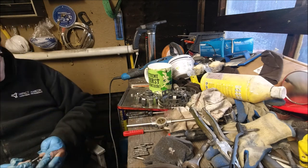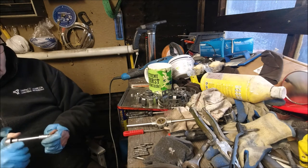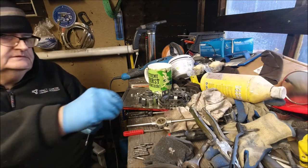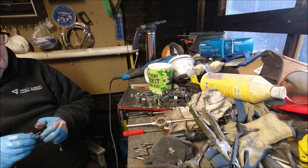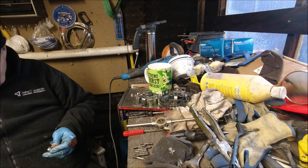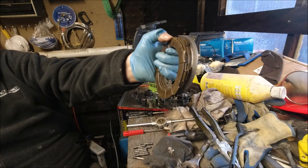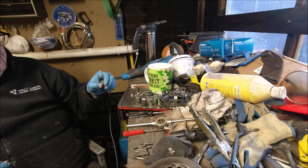What I've also been doing is checking out the clutch bits, and it looks like the corks themselves have been bashing on the outer bell. Let's just turn that round and do that end. So I'm going to order a new set of clutch plates. The corks are a bit bashed on the outside edge, the steels are fine. I don't know if you can see that, a bit worn. Probably be good enough to use, but while I've got it apart, do it properly.